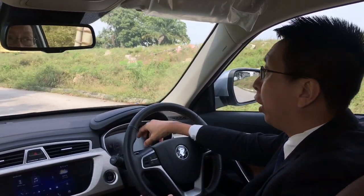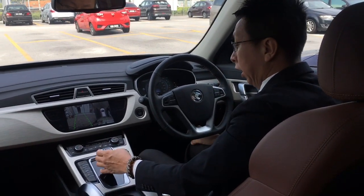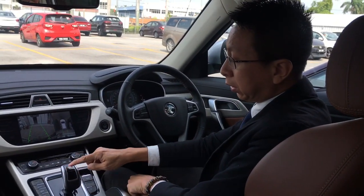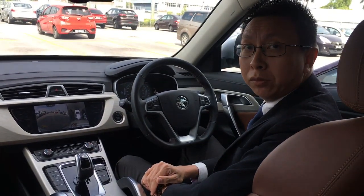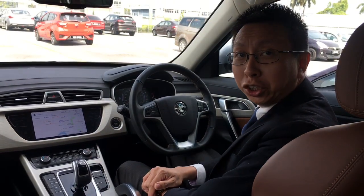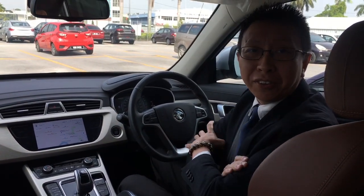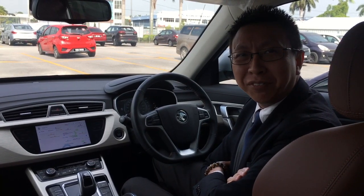If you're driving on a slope in traffic, like during balik kampung, and inching bit by bit, the gearbox may show you a warning sign that the gearbox temperature is too high. Now we've parked — all you need to do is press the P button and the parking brake and parking gear will be engaged automatically. That's all for the sharing today. Selamat Hari Raya Haji — see you in the next episode. Drive safe, balik kampung!